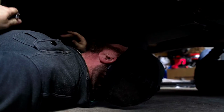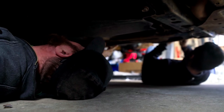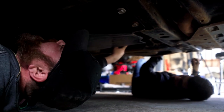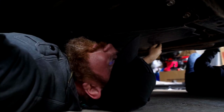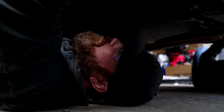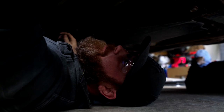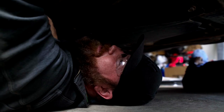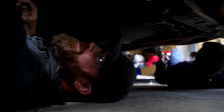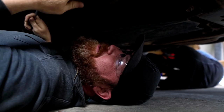What we're actually talking about right now is that because we have a lift on here, the CV joint is at a more extreme angle. It connects to the transfer case, which is how you shift into four-wheel drive — it engages the front drive shaft. Because it's at an extreme angle, it's already starting to leak because it's pointed more down at the ground. We just noticed that now. Probably not a major issue right now.